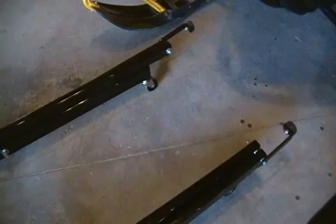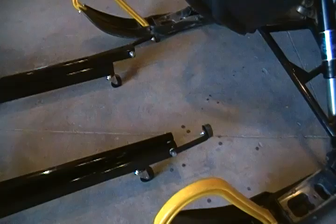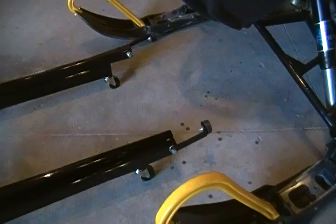The rear of the lift has got these fold-up, fold-down arms with 1.5-inch bumper pads on them that don't slip. They work really great. They're quick versus the ones that thread up. You got to thread them all the way down to put it underneath your snowmobile, and then you got to go back there and thread them all the way up. These you just slide underneath, fold them up, lift your sled. Same thing. Drop the snowmobile down, you can pull it right out and they'll move.